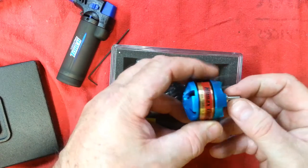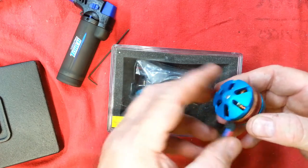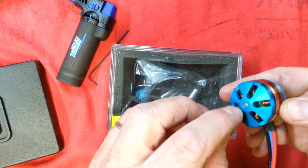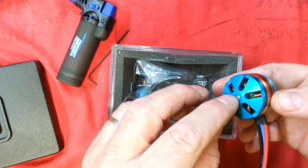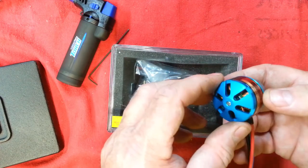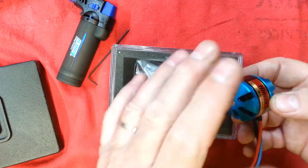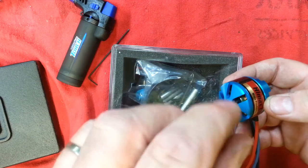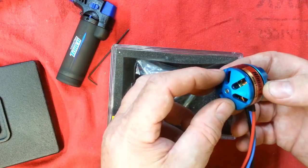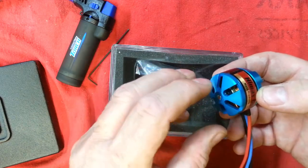Now we're going to move the shaft. The shaft is not only held in position in this back plate with the set screws — it's also held in position with a press fit. That means the aluminum hole may be slightly smaller than the shaft. Another problem is when they overuse Loctite: they put a drop in the hole and run the screw in. There's way too much. The screw kind of acts like a piston and pressurizes the Loctite, squeezing it around any gap between the shaft and the back plate. So it takes quite a bit of pressure to initially get the shaft to move.